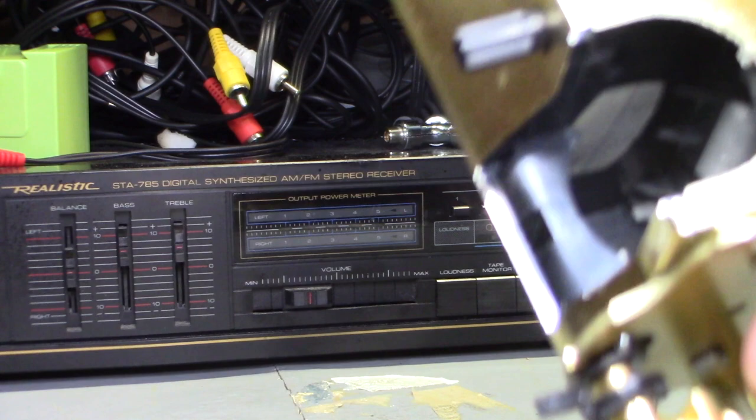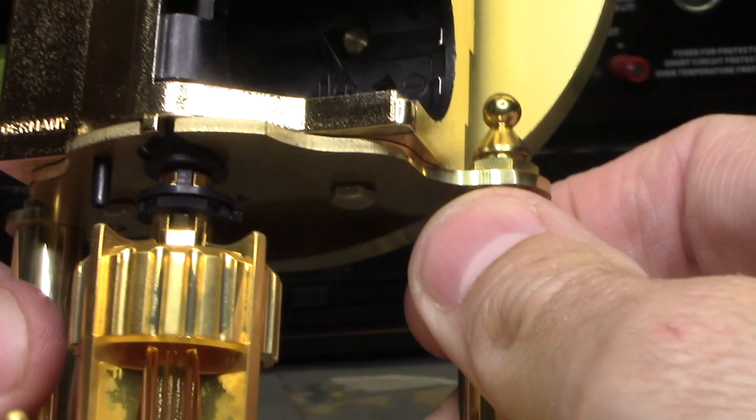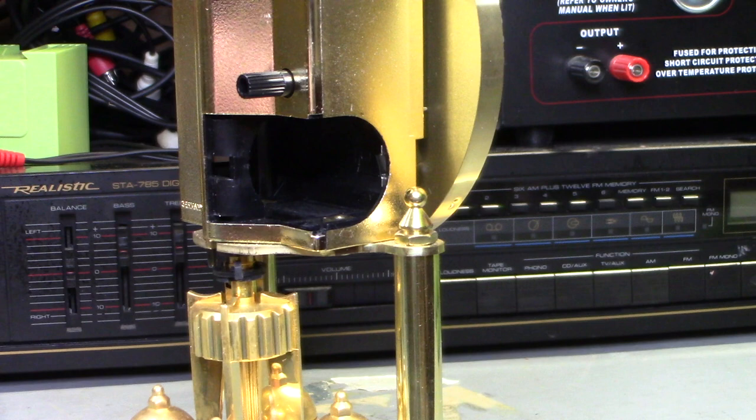Hopefully you can see — I'm trying to get some light on here. Inside the back, you can see that silver thing in the back. That is one of the connection points for the battery. Take a little sandpaper and clean that — that's the first step. The second step is over here — there are two more connections. Make sure you clean these two connections. And once you clean those two connections, you'd be surprised: 99% out of 100, this clock is going to run. So if it just has a little bit of dirt on there, or the connection is just not right, they're very temperamental and it won't run.